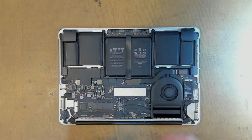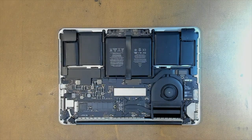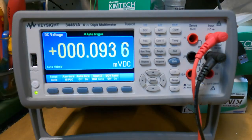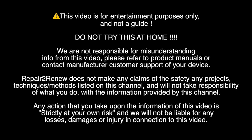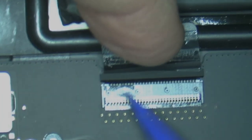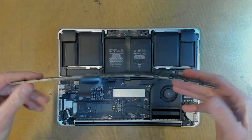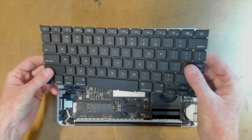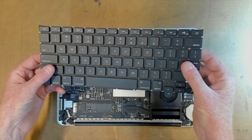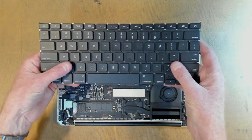So what we're going to do is diagnose this. The first step is we're going to disconnect the keyboard here and have a look at that little connector. We'll look at that under the microscope. We'll unplug the connector and plug in a spare keyboard to see if it fixes the MacBook — that way we can tell if it's the keyboard itself or the logic board.